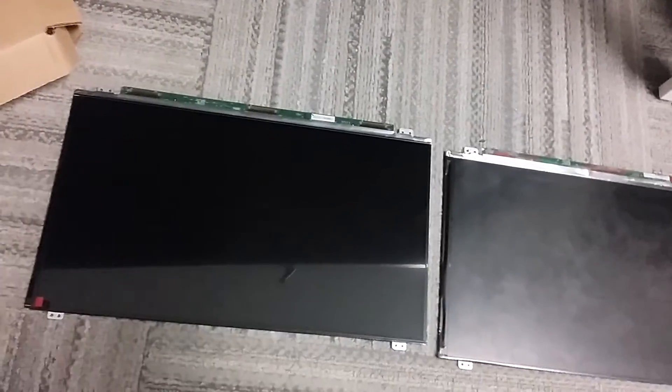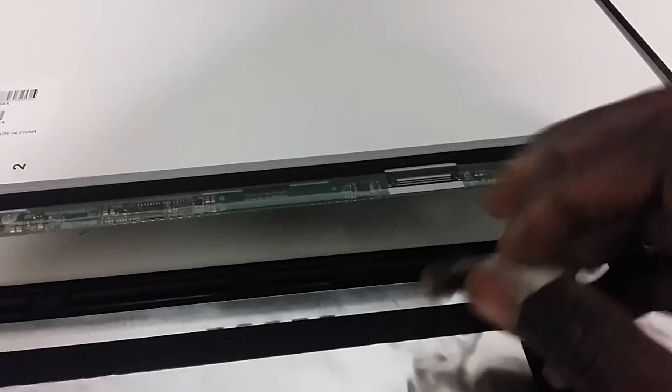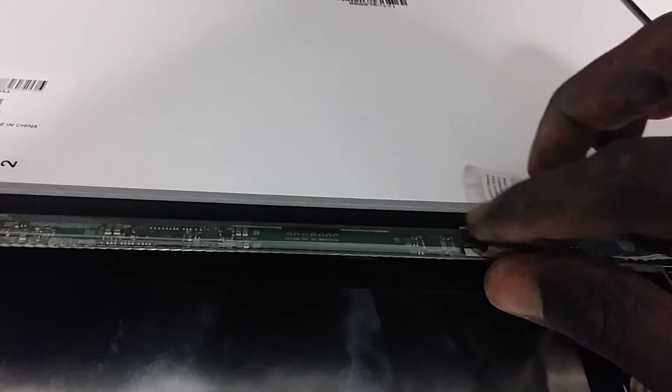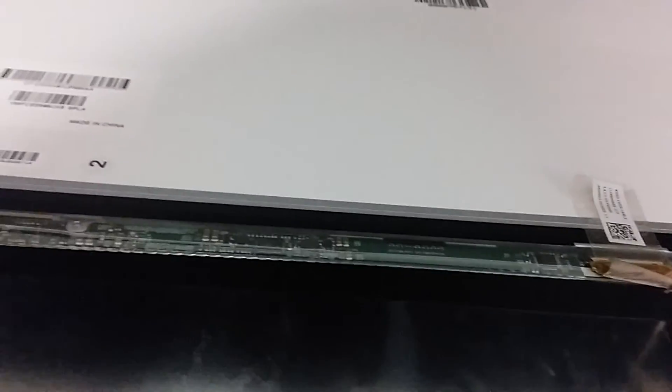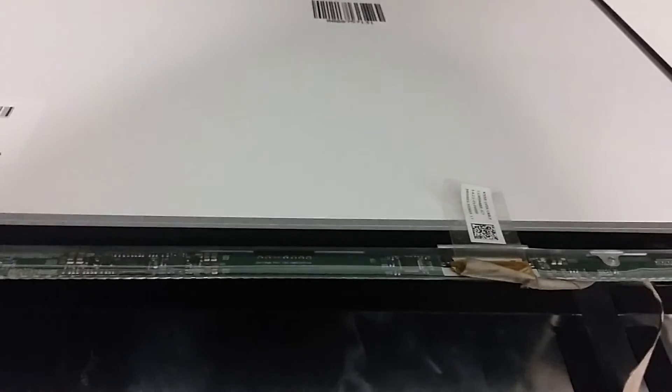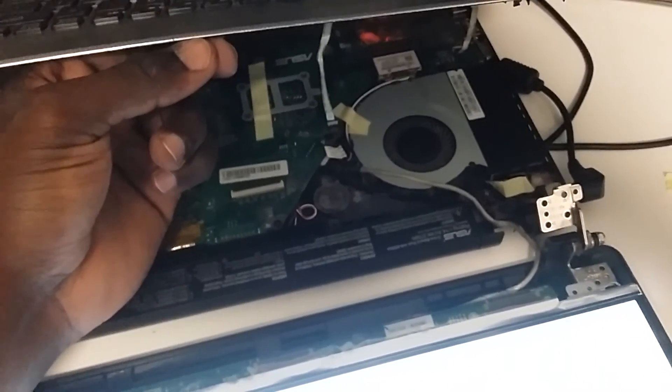This is our new screen. Just as you removed the cable from the old one, put it back on the new one. I'd suggest getting some tape and taping this up right here just so it doesn't fall off. After putting it back in, I re-inserted the battery to see if it's working properly. The screen is functioning correctly. I connected the keyboard cables so the laptop can recognize the keyboard, then turned on the power button — and this is what we get.